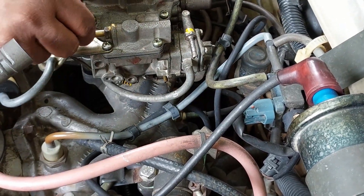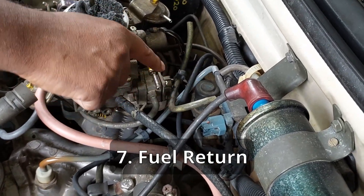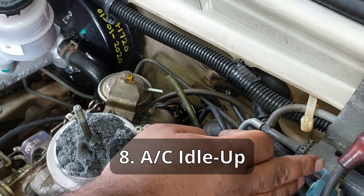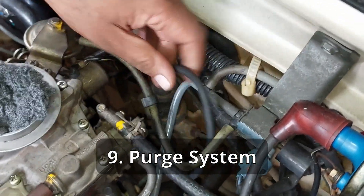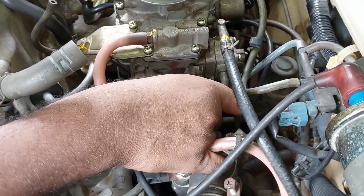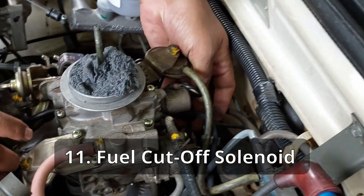Check the hoses for any damage. This is the fuel inlet hose coming from the fuel tank. This is the fuel return line for excess fuel to return to the tank. Then there is the AC idle up vacuum actuator with a vacuum modulator - the connection from the modulator goes to the AC idle up vacuum actuator. There is also a connection for the purge system to the lower half of the carburetor, and a connection on this side for the distributor advance mechanism. Do take a photograph of all the connections - otherwise it would be very confusing to reconnect. There is also an electrical connection for the fuel cutoff solenoid.